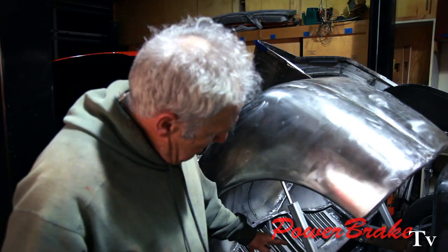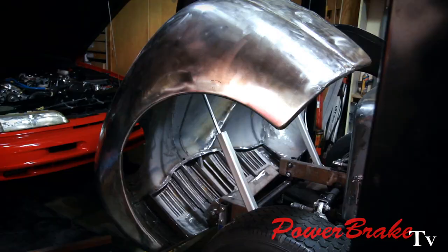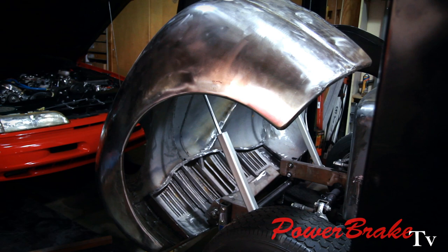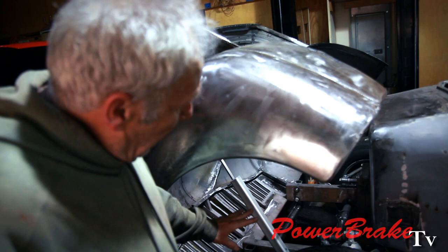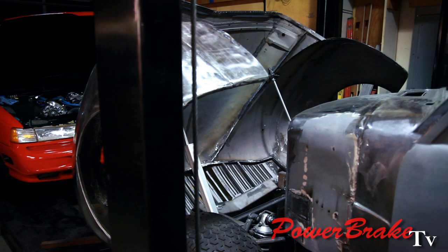We've built a tow bar at the front — detachable, just four bolts. That'll help in showcasing the car. The transfer case will sit between the wheels on that crossmember. We're ready to start going battery tray, transfer case, and if we can get some sponsors, electronics. The weight up there will be a good thing because this is going to want to lift the front tires when you hit the gas.